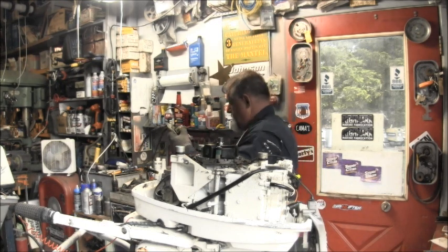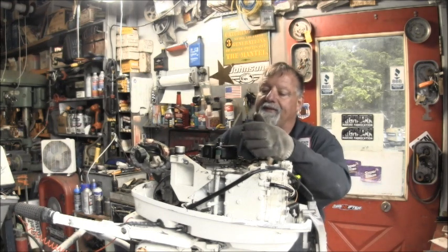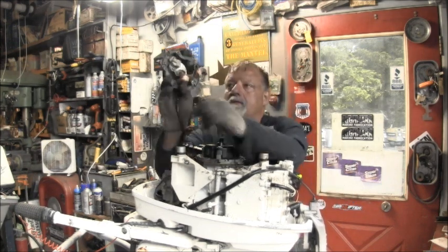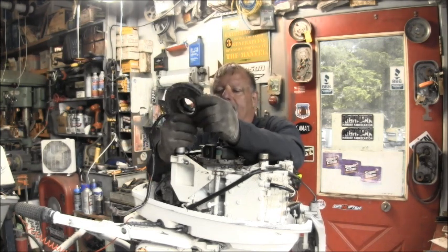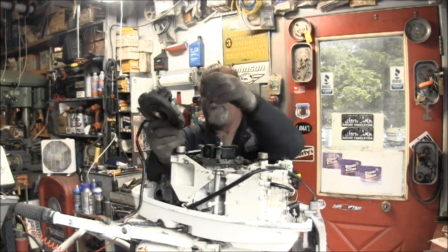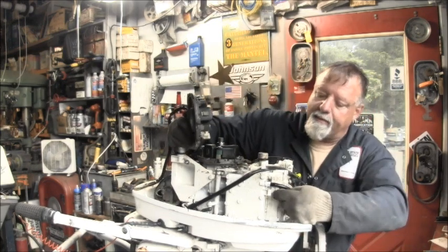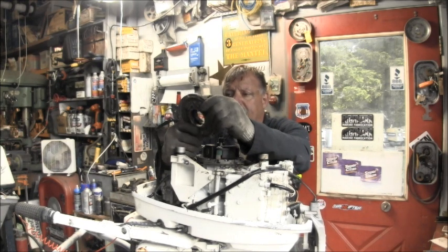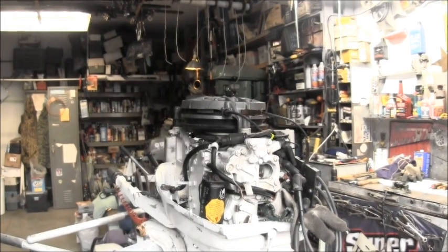These CDI setups have the trigger kind of built in and all that, whereas the external CDI has this setup. So I'm thinking it'll probably be easier just to take this one off, put this one on, and I've got the place to mount a CDI, so it's already bossed. So I think I'll go that route. Since I got to take it off anyway, at least by going this route, I won't have to run the wires. You understand? Okay,